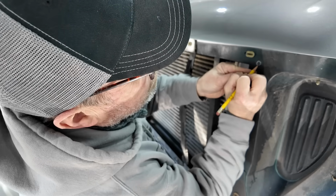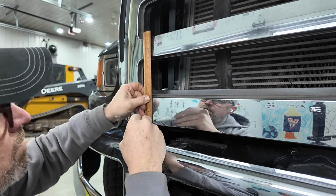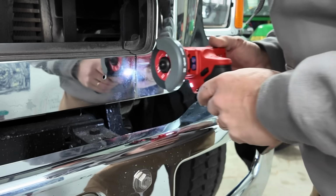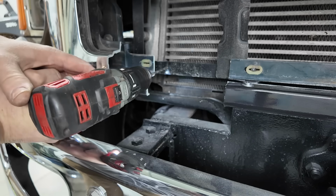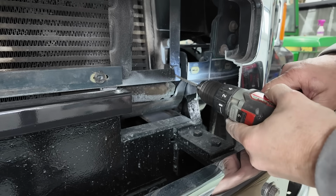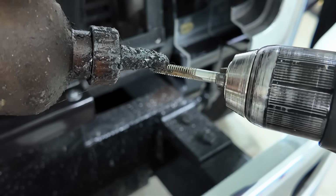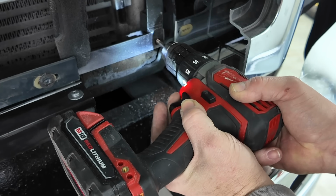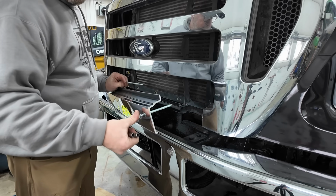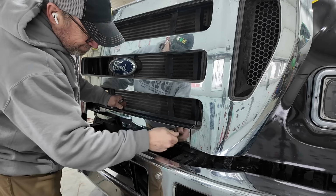I had to drill some holes in the hood. I had to make some modifications to the fasteners that I used. And then finally, I had to cut the bottom of the center portion of the grille out in order to allow enough clearance for the hood to tip up. And since my pump is mounted directly on the crankshaft in the front of the engine and it obstructs the hood from opening properly, I had to fasten and attach that bottom portion of the grille to the actual frame of the framework of the radiator mount itself. So that took a little while.